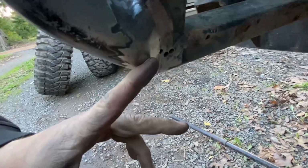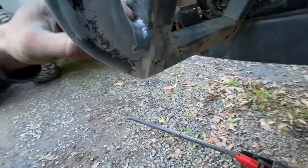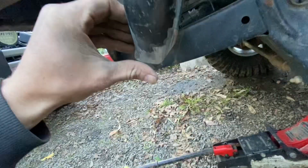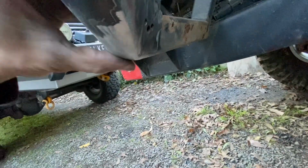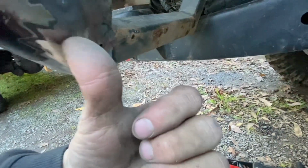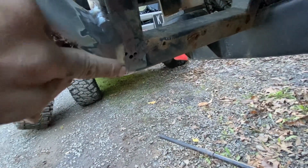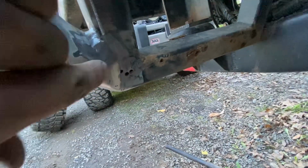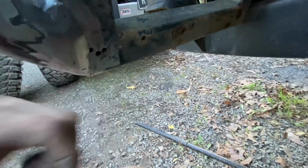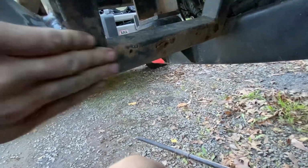So what I've done is I've made this side flush, so it looks a bit nicer from there. It's flush on the bottom obviously, so just round that off. And then here I smashed it with a mash hammer, that lip of the tube, so that it was more angled into the square, and then I ran a bead down that and cleaned it off, so it was smooth.